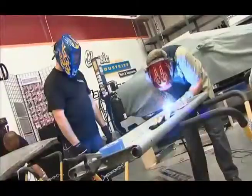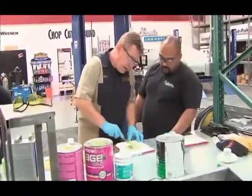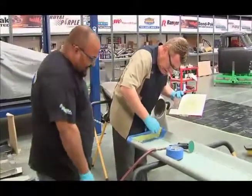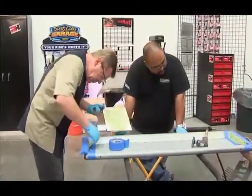We were working on the tailgate and found that one side was slightly low. We went ahead and used a big welder to build the edge up, then squared it off with the grinder. Afterwards, we mixed up some body filler on a non-porous mixing board with the correct amount of hardener. We taped off the panel and spread the body filler on. When working with body filler, I prefer to mask the panels with tape — once you spread your filler on, you pull the tape off and feather the edges to blend it all in.